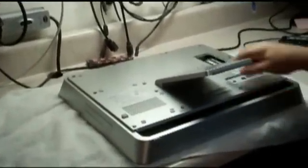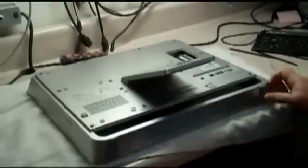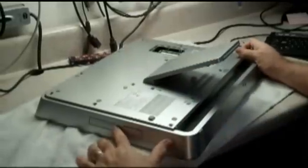So your screw holes are covered up with rubber covers, so just pull them out and put them aside. Remove the screws at each one — you have four screws in the base that you have to remove. Then the back is held on by the CD/DVD drive and the ports over on this side here.